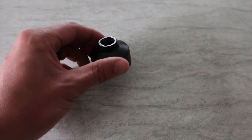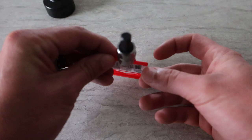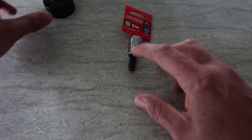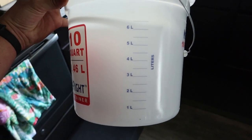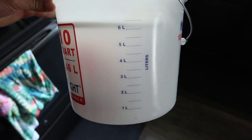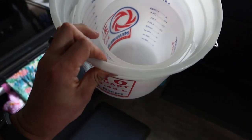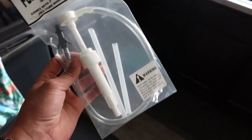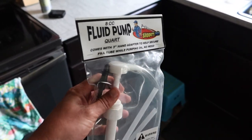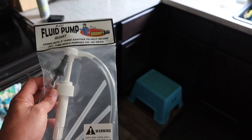For the SST, you're going to need a 32mm socket for the bottom of the oil filter, and an 8mm hex for the drain and fill plugs. I also picked up a small bucket from Lowe's to measure how many liters are coming out of everything I drain today. I buy a lot of stuff off Amazon — this was shipped within two days, so I'll link it in the description below.